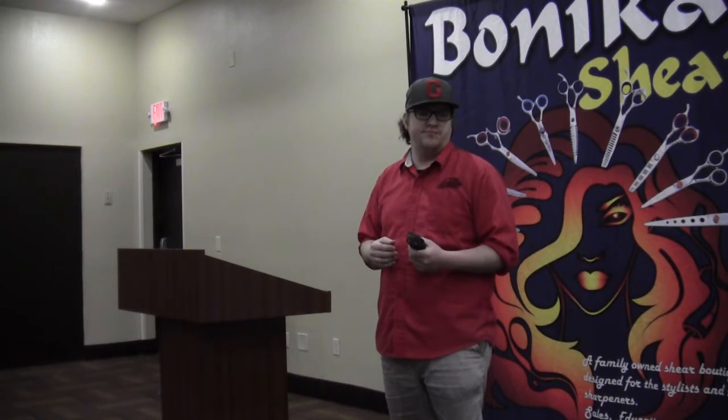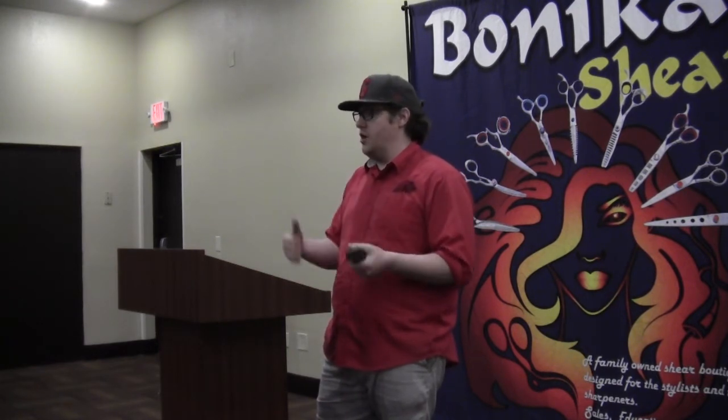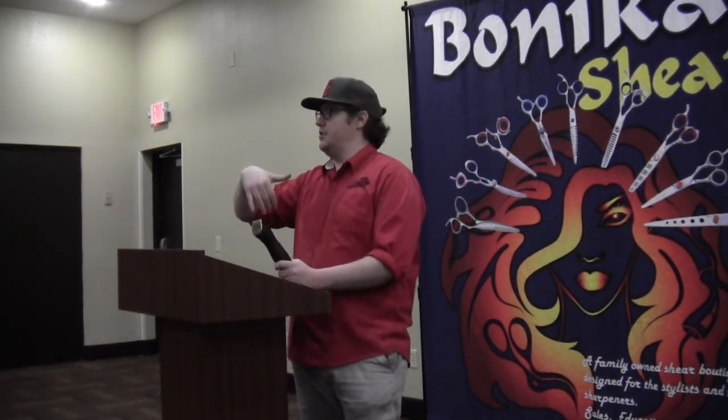The idea is to be aware that this is what's wrong when the battery dies or won't charge. The complaints I was getting were that the clipper was staying on and the battery wasn't charging. As you ask more questions you hear it was staying on, and naturally the battery is going to die over time. And because it's on, the charger doesn't allow it to charge — it has to be in the off position. Because the hair is wedged in there, it can't get to the off position. So rather than looking at parts, this gives you a place to start.